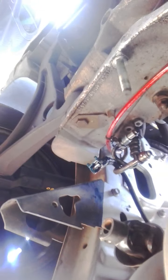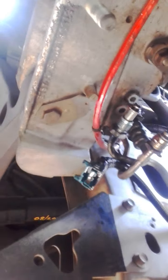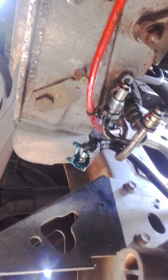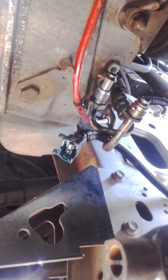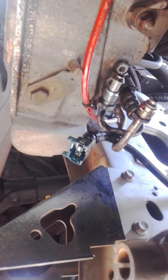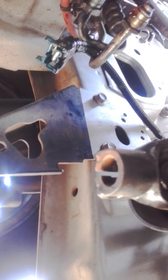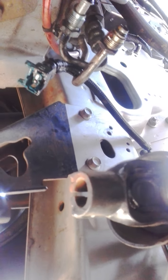This is the area you've got to work with — plenty of room here. You can see that little wiring harness I was talking about before. It's a speed sensor — it changes the pressure on the rack when you're on the highway and when you're running around shopping centers. And there's the yoke. I only took out that one bolt, didn't need to do the one on top, so that was quite okay.